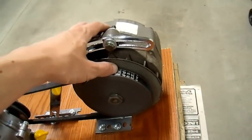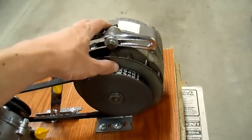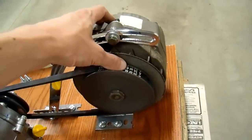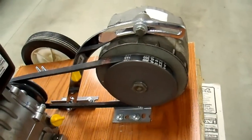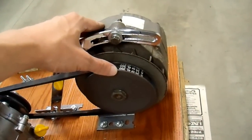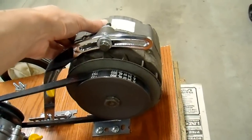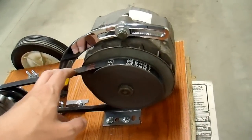The reason you need this large pulley is because any automotive alternator, if you run it at full field current — which I have to do just the way this is set up, I cannot regulate my load — will be running at full field current for a long period of time. Any automotive alternator that runs at full field current continuously will overheat if it runs at a high output current. So I need a way of regulating the output current so it doesn't overheat. As long as the rotor keeps turning, that full field current won't burn up the rotor, but the stators will contribute to an overheat condition after a while.